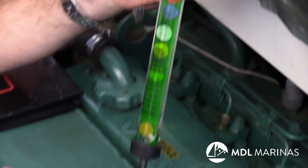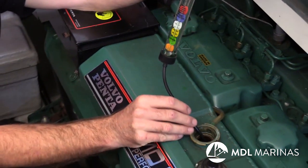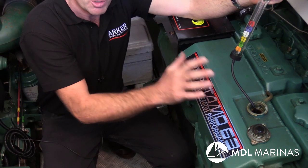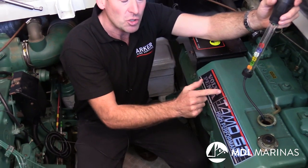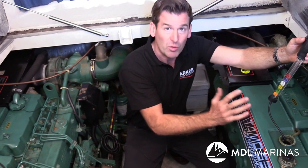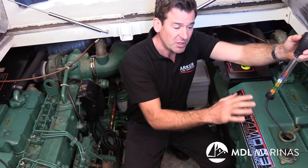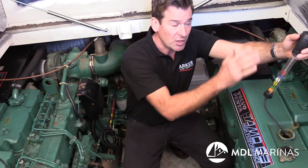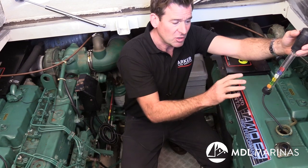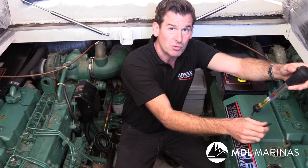If the coolant is of a certain age — between two and five years — it has corrosion inhibitors in it which can wear off. Depending on what type of antifreeze you have, you'll have a two or five year limit on when it needs to be changed. If it's over five years old, I'd certainly consider getting it changed for winter, because without the corrosion inhibitors, even though the concentration is good, it can cause surface corrosion. You can normally tell because the antifreeze starts to turn brown as rust forms within the engine.